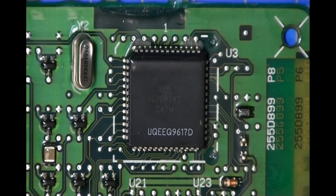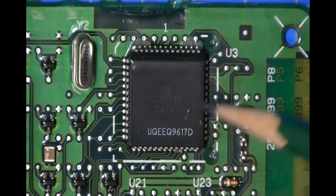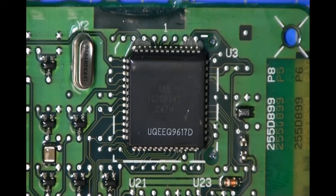Here is about as close as I can get to the microcontroller. It's hard to see through the humidity sealant, but what we're looking for is called a mask number. The mask number is the actual photographic mask used to fabricate the part, and it cross-references to the actual industry-standard part number. For a Motorola, this would be a 68-series — this one is an HC-11. The mask number right here says C47M. A mask number is always an alpha character followed by two numerics followed by an alpha.